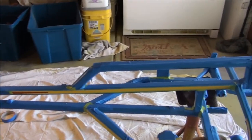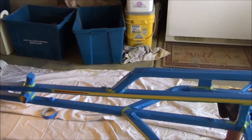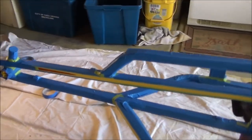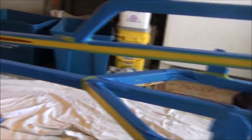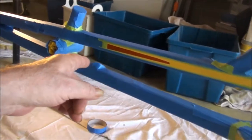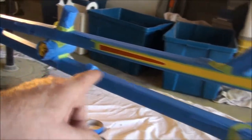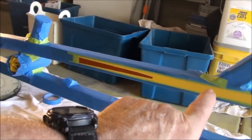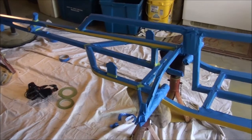I'm pretty sure I'm going to leave some of this yellow in the design. If you remember, putting on that candy orange — the first coat turns gold, the next turns copper, and the next turns candy orange. I'm thinking about spraying this so it looks gold, then the next time I paint with the orange I'll pick it up partway and it'll be copper, and pick it up again further along so it basically rainbows out to a gold. I'm sorry to put viewers through all this boring painting detail, but this is a custom paint job and I wanted to share it.